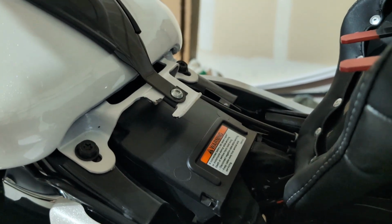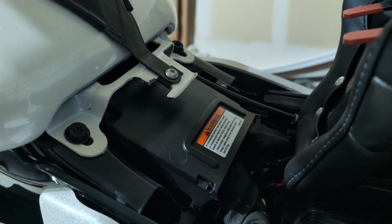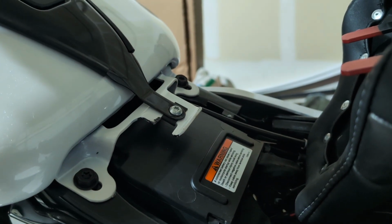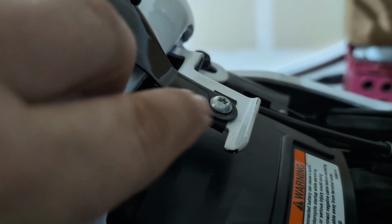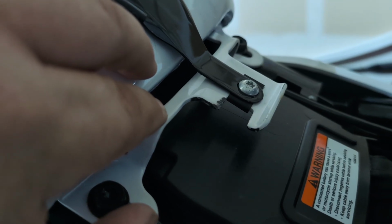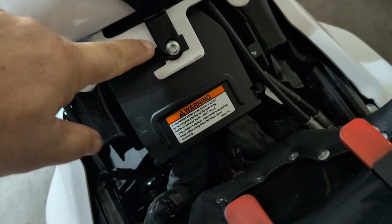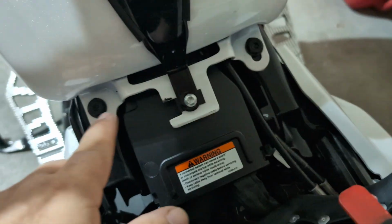So this is how the mounting tab looks on these new bikes. Harley and LePera have this little tub that I'll show you in a second that slides over this, while Saddlemen and Bad Boy Cycles have this little squared piece of metal that actually sits right here and kills your paint. Even on metal, you can tell that it's destroying this piece right here. You can see the wear and how it's messed up. Well, what Mustang did is they put this awesome mount right here. So instead of using this little portion, these two tabs mount right here.